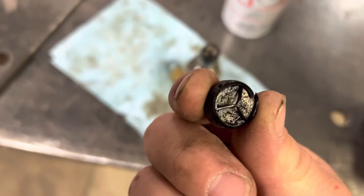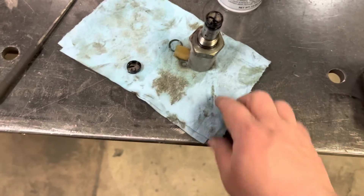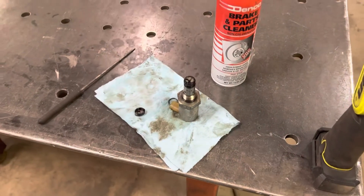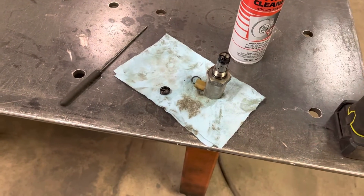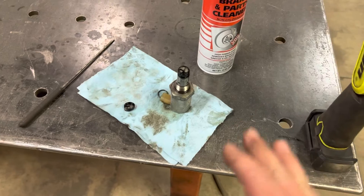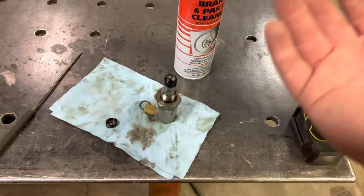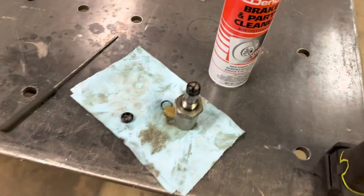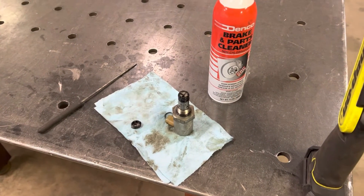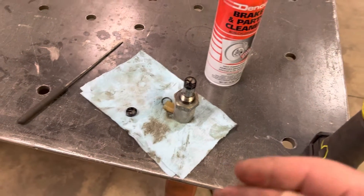I'm glad I opened it up and was able to see that. There's a lot of stuff on there — it's mostly just plastic from the screen getting shoved around, pushed, and mangled. There might be some residuals in the system, so I may have to change the screen again. I'm going to keep some in stock — probably buy another IPR valve just in case. If you can get everything out, you can just pop a new screen on with new O-rings and you're good to go.